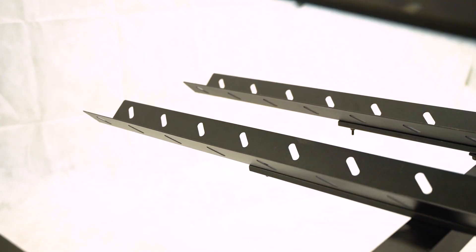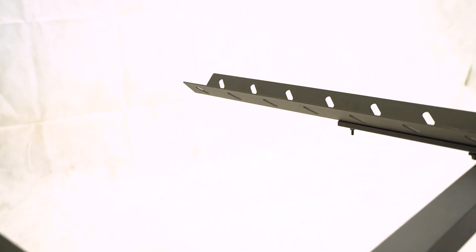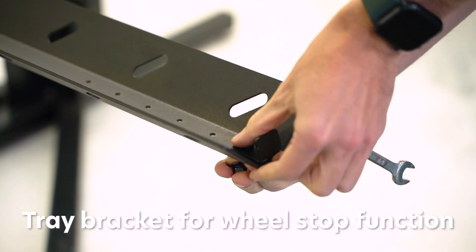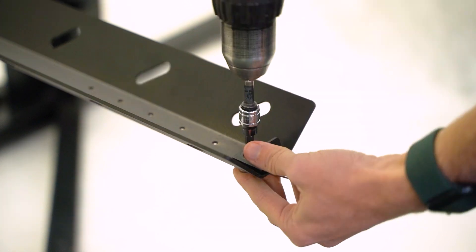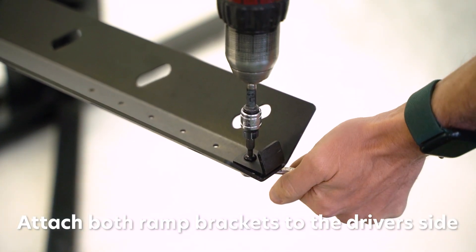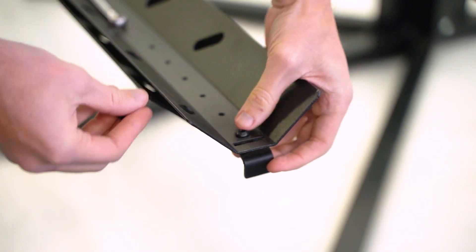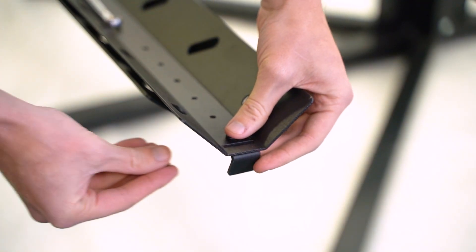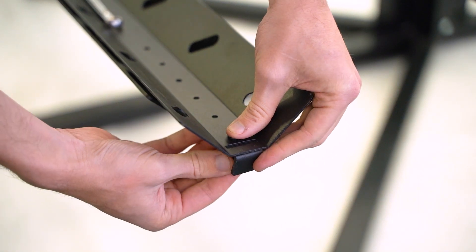Remove the trays and ramps from the platform and begin connecting the first tray to the twin tube. For the tray, attach the ramp bracket up onto the top surface of the two trays as a wheel stop. Attach both ramp brackets to the driver's side and use the passenger side for loading. For the ramps, mount the ramp bracket pointed down on the bottom surface of the ramps to use as a ramp hook.